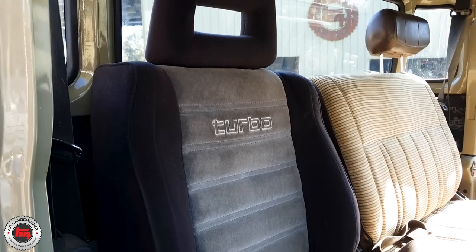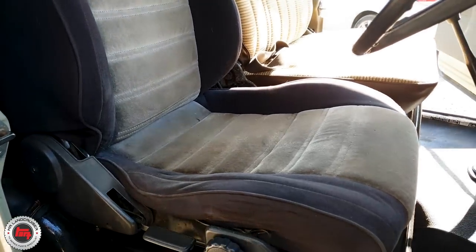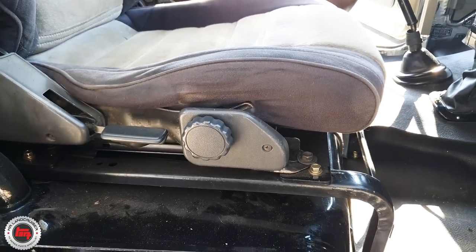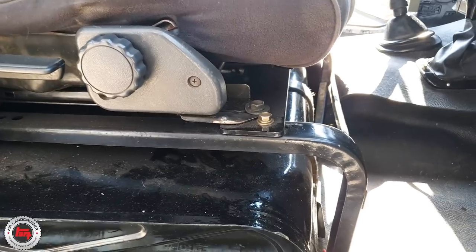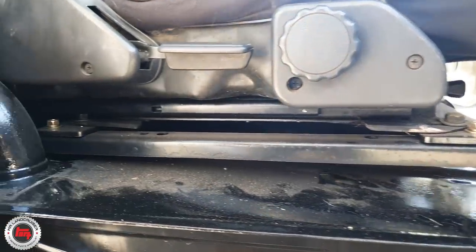You've probably noticed the seats — 60 series turbo seats. Because this is an HJ45, we've got the fuel tank under the seat. That was a bit of a challenge; we've had to custom make adaptor plates for the driver's seat and adapt the seat frame on the passenger side to take the bench from the 60 series. That's come up really well — really pleased with it. You sit pretty high and comfortable, and the eye level is good.